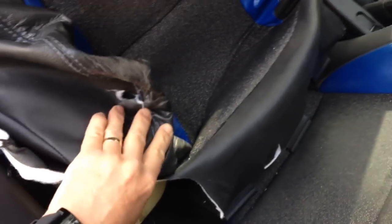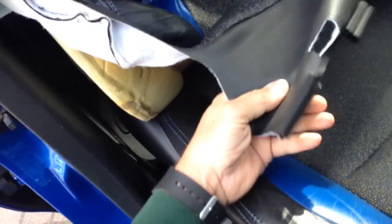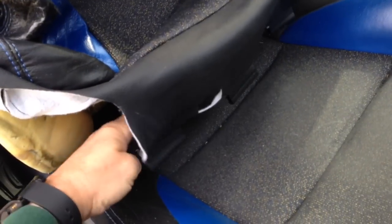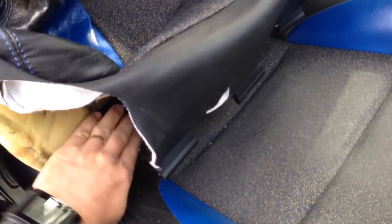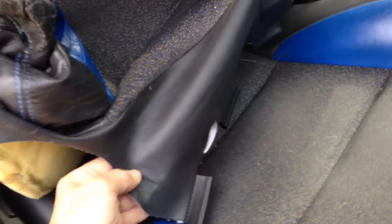Now to remove the seat cover we need to release all of these material catches around the bottom and peel it back as much as possible. That's allowed us to pull the seat cover from underneath the seat, pull it out forwards, which gives us access to underneath for stitching in a new patch. Interestingly, there's quite a bit that actually goes under the seat out of sight — it's actually big enough to use as a patch for the sides. So we'll take this patch out and replace it with a piece of general-purpose leatherette; colour mismatch doesn't matter because it's out of sight, and we'll use this original piece for patching in at the sides.